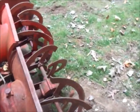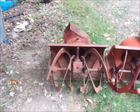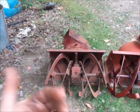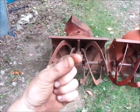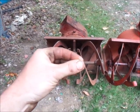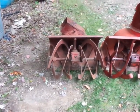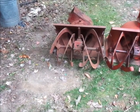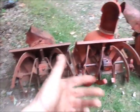I used a square chute for years. I twisted off two fan shafts at the safety clutches. A lot of that was from the nylon nut on the back of the slip clutch backing off, which then gave it more torque and twisted the shaft off. A lot of the problems are mainly maintenance issues. Then we segue over to the deluxe snow blower.